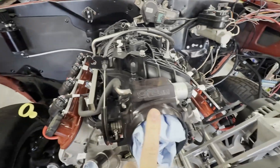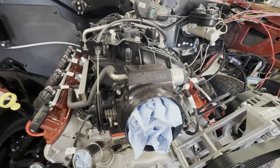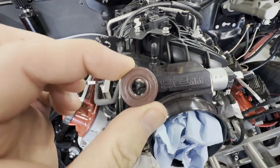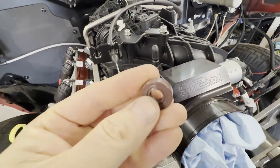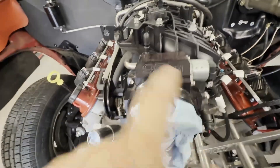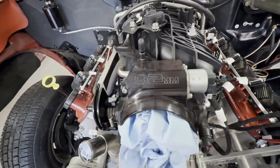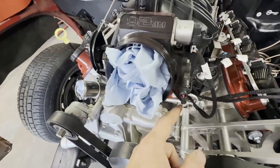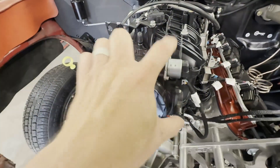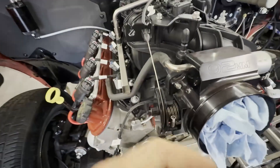Also, when we get the intake off — I might have to take the intake back off and put it back on — but I'm going to take this throttle body off and do a mod to it. I was watching another guy's channel; I can't take credit for this — it was MRE Motorsports — and he suggested putting a seal on the throttle linkage side behind the spring to prevent air leaks. I've heard and seen videos on YouTube that these things are notorious to whistle and suck air, and it causes tuners nightmares. I did use GM idle air control sensor and throttle position sensor — factory OEM rather than aftermarket knockoffs — so I'm hoping that will help. We're going to take this spring out and put this seal in there.